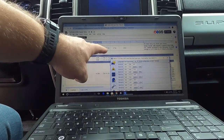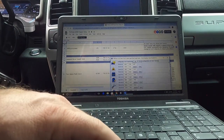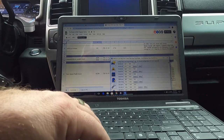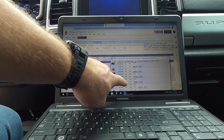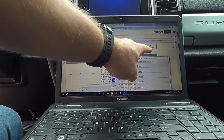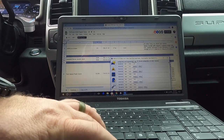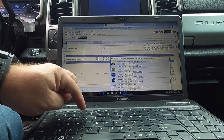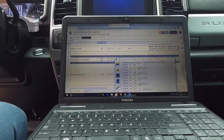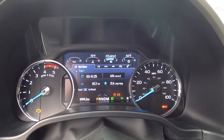Now DPF on screen. Let's see here. There's a bunch of notes over here. So let's go to 0702, which is this one here. It's going to change the second number in the first set. Mine's at 7, and it says if 7, then put F. So we're going to put F there, and F. Then we'll write. Hit OK. All right, this thing's doing its thing again. Okay.